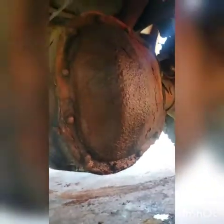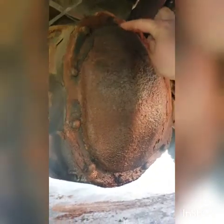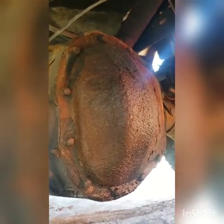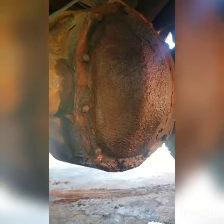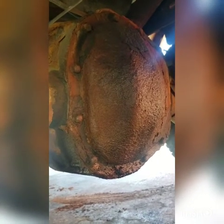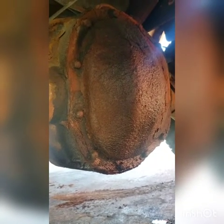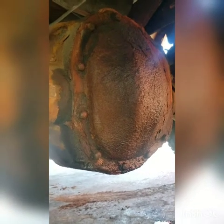I know the diff pan's not going to fix that, but as you can see at the top of the cover here, it's starting to leak a large amount. So either the cover is completely shot, which judging from the looks is a likely possibility, or the seal's gone. I'm going to take the cover off and try to see if I can fix it. You are under an almost 19-year-old truck.